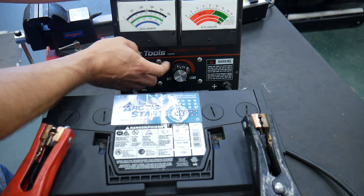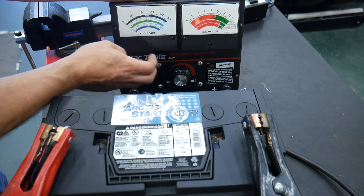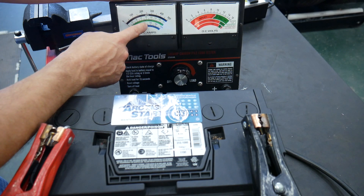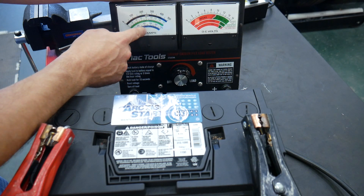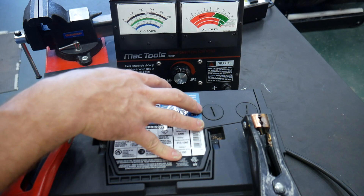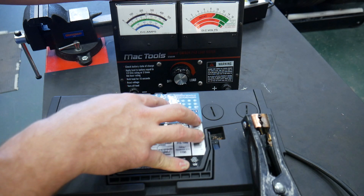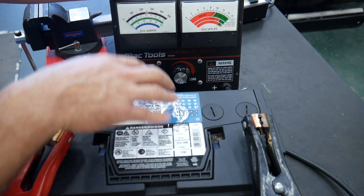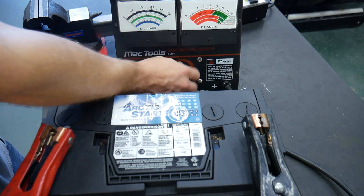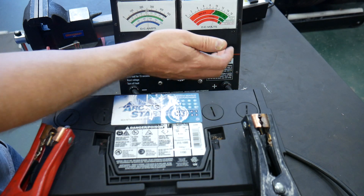What I'm going to do is create or add the load. This is a carbon pile. I'm going to increase the load by allowing current to pass through the carbon pile until I read 500 amps. When I read 500 amps, I'll read my voltage and that will tell me whether this battery — since I know it's charged and has a good open circuit voltage — is good to return to service. I'm going to increase the load until we get to 500 and count to 15.